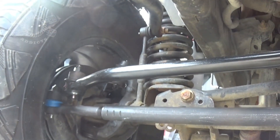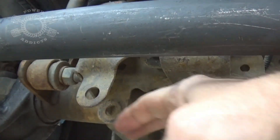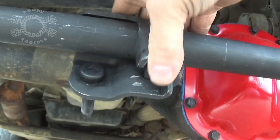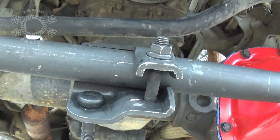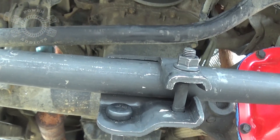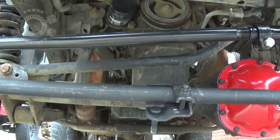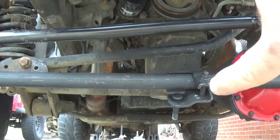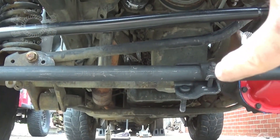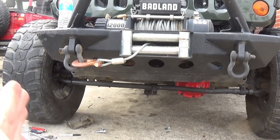Here are the contact points for your factory JK setup. You've got one right here coming off the passenger side front wheel area — there's your spring, track bar connects here right underneath there. Those two tabs are where the end of your steering stabilizer goes. It comes over and connects to this bracket on the middle of your tie rod. Notice it slides everywhere, so whenever you purchase one and you're doing a heads-up swap, just mimic where your old one's location is and you're good to go.